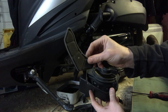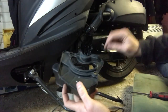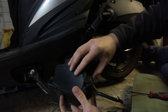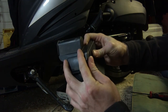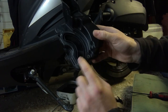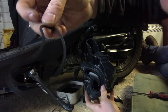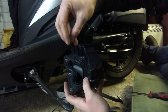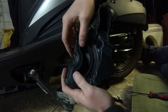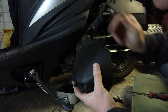The cooling fan filter is now clean — or cleaner. It's going back in the housing. We've got the lid with the plastic bits which fits over the filter and keeps that in place. The clips need to be clipped back on, top and bottom, and the screw goes back in. On the back there's a rubber sealing ring — you need to check that and make sure it sits in its groove. So I put the screw back in and we'll get this back on the bike.